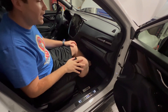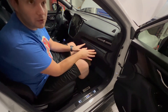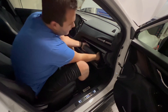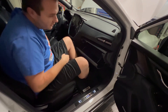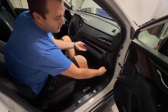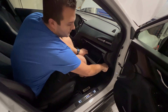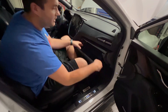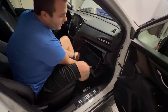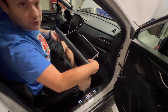We're inside the car. Your cabin air filter is located behind your glove box, so we're going to have to remove it. You don't need any tools to do this job. Open your glove box — it's just easier to take everything out. You have a little plunger over here that makes sure it doesn't drop. Just put your thumb, pull out to the right, then pinch in and pull down. From there, you can just pull straight out — and there's your glove box.